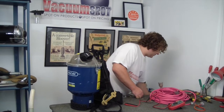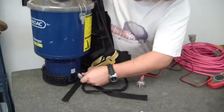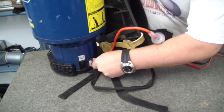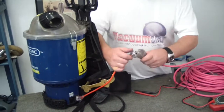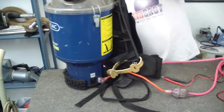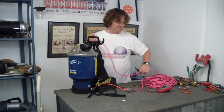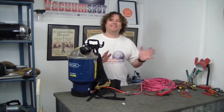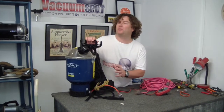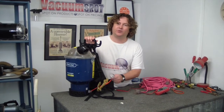I've got one of those. There's no need to test it — that's brand new. So plug that in there. Win! Easiest repair I'm going to do all week. Simply testing the continuity has saved a whole lot of time pulling this apart. I'm super happy about that. Old cord out, new cord in, vacuum fixed.